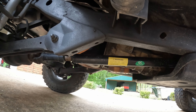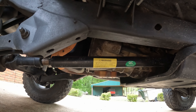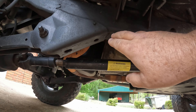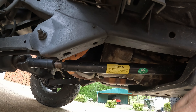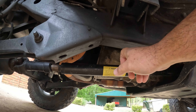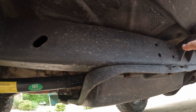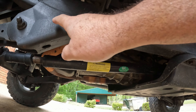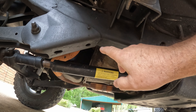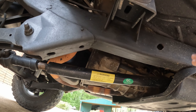So where I'm going to be drilling the holes — a lot of people drill them right in the center of the frame, but I'm not. I want to drill mine up through this hole right here. Three-eighths inch is what I want to do; I saw another guy on YouTube do that. People worry about drilling in the center weakening the frame, but I don't think it will at all. It's got round holes in it everywhere. Right here it's captured by a brace that's welded in, and you're drilling the hole up in a captured point where there's no chance of one hole weakening the frame.